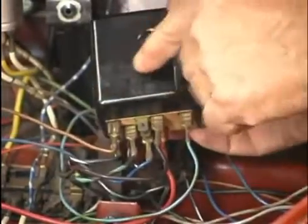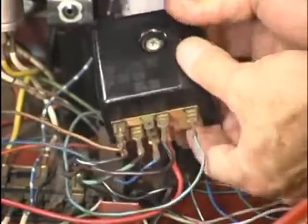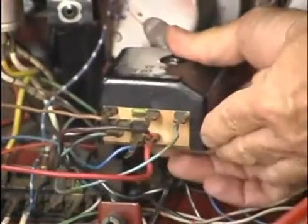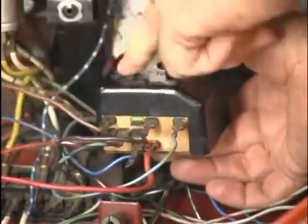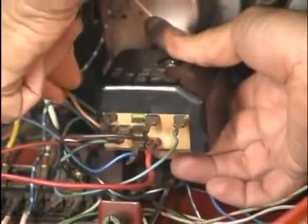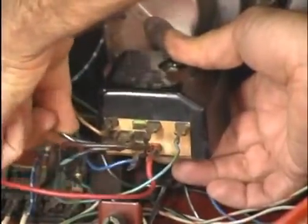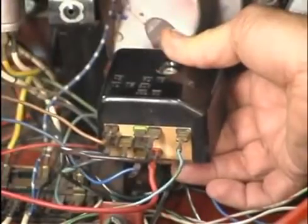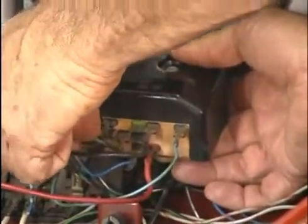All the numbers and letters for these wires are on the side of the case. Starting from the top: the brown wire is marked minus S. The black and white wire is our left turn signal — marked VL. The green and black one is our right turn signal — marked VR. Then down below that holds the end of the cable that opens the trunk, attached to the lever inside the glove box, so that screw has to come out so the cable is free to move when you pull the dashboard back.